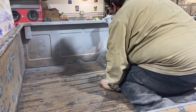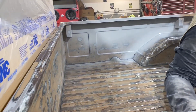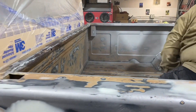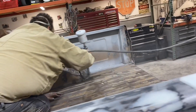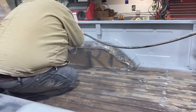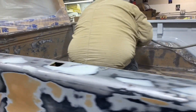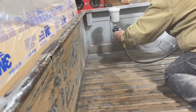Trying to get the fan adjustment right — it was a little too broad. I'm using a not-the-most-expensive Harbor Freight gun; I think this was a $139 gun. It is the HVLP — high volume, low pressure. I'm running it at exactly 28 PSI, and that's 28 PSI with the gun open, running a 1.7 tip.